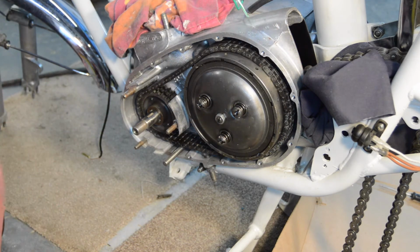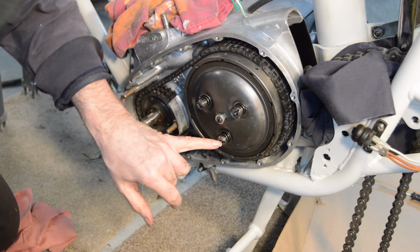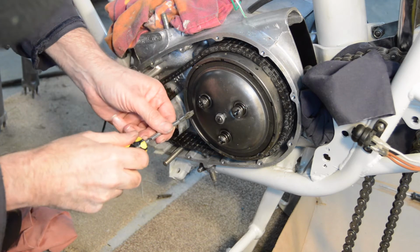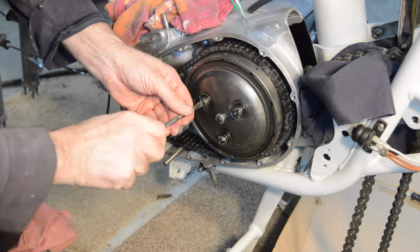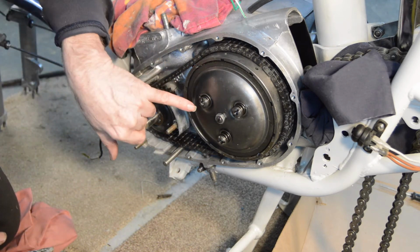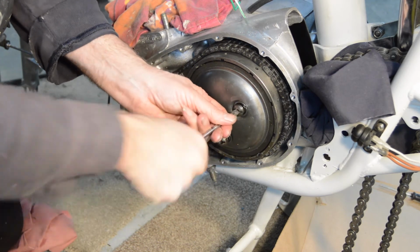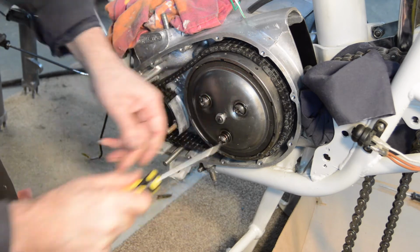And as I mentioned when I was taking these apart, there is a special screwdriver for this, but ours was so high up that the bolt head didn't protrude through, so I will just take them down level and then we'll do the clutch adjustment later. So that's just below the thread, which is where it was when it came off. These have all got to be even. Just below the thread.